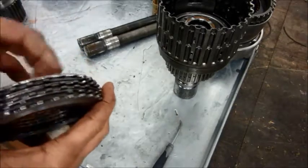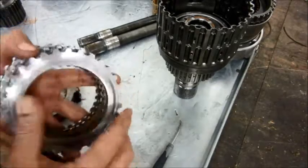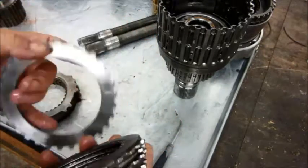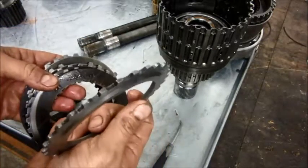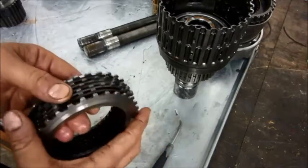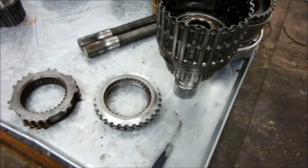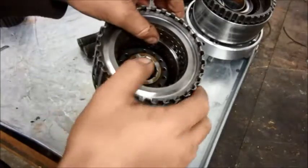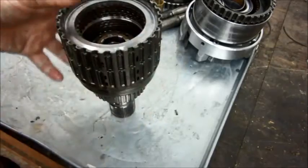For the forward input clutch, I was able to add one more pair of clutch plates by cutting down the housing so there's room for the clutch plate to sit inside it and give it the clearance it needs. I cut down the top plate on the edge so it has more clearance with the snap ring, and that allowed me to add one more friction and one more steel plate, giving the input clutch a little more torque capacity.